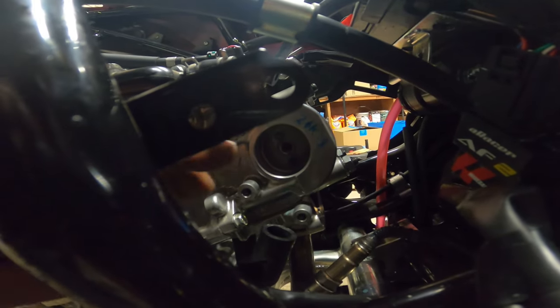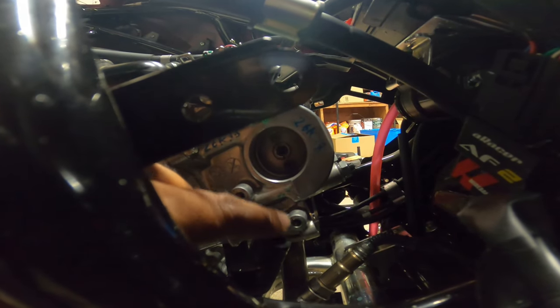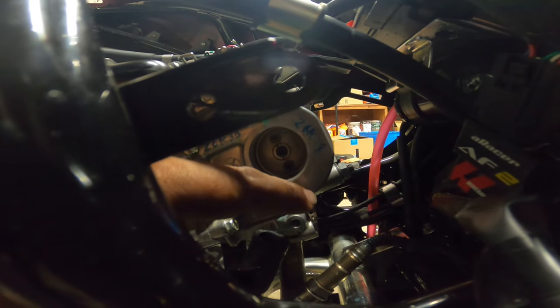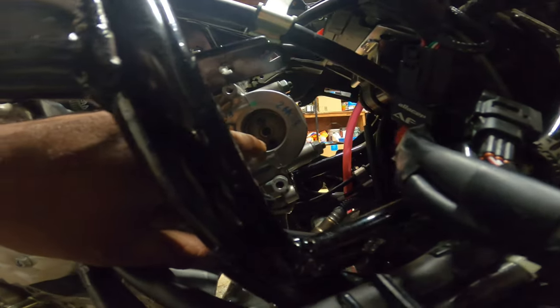Okay, this is in the actual repair manual as well. I'm going to walk you through it. Now, you'll see here, these two bolts coincide with these two markings here on your casting. They should be perpendicular, pretty much identical angle. On top of that, the word KWN should be on top. So it should be these two bolts perpendicular, and the word as well, centered perfectly in the middle of this circle. All right, guys?